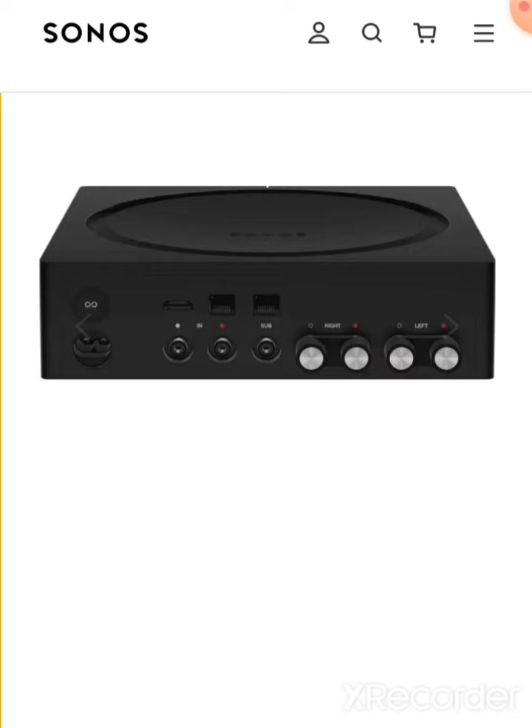Another potentially decent use — probably uncommon but not a bad one — would be to get speakers that are efficient, that have a high sensitivity rating, so that they don't require a ton of power to get a decent amount of volume and still produce a full range of sound, most notably lower frequency sound — bass waves. Something like a Klipsch speaker, which are notorious for having high efficiency, or some other type of floor-standing speaker that has high efficiency, would be acceptable to run without a subwoofer. You'd probably need a pretty good subwoofer if you were going to blend it with full range floor-standing speakers, producing those super low bass waves below 50 or 60 Hz, and you'd want it to be tight and punchy so it didn't make things sound muddy.